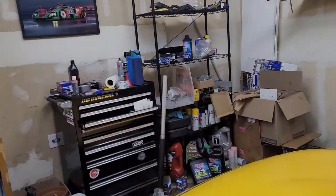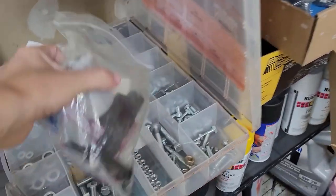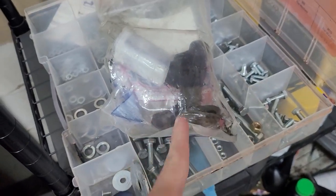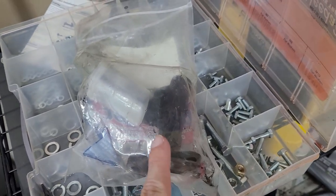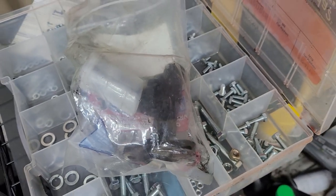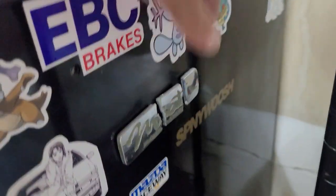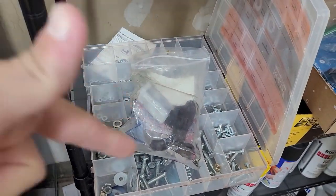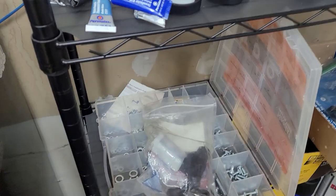It was a fluid issue because the fluid gets hot and behaves differently than when it's cool. One other person online suggested that deep inside the clutch master cylinder there's a little seal, and the pushrod isn't supposed to touch that seal. But if you went through the Flying Miata guide adjusting your pushrod, maybe you adjusted it too far — you punctured it. So now when it's hot, the fluid can slip past it, making it so you push the pedal and it's not doing as much as it's supposed to, because some of the fluid's pushing past instead of just pushing fluid.